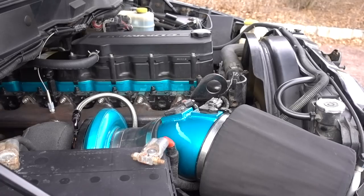Flipping the manifold up brings the turbocharger up a little bit. I chose mine to run in the down position. As far as oil feed and drain, I actually sourced separate components and made my own stainless braided oil feed and return rather than buying a kit. I'm actually going to do a separate video all about stainless braided lines and fittings and how you can use them in your fuel system, oil feed, and drain — there are plenty of applications where they really clean up your engine bay.